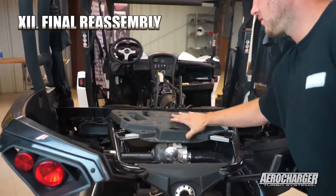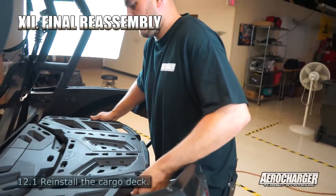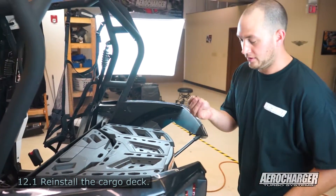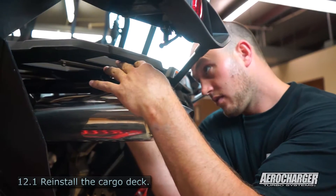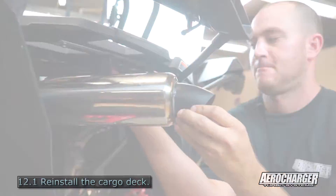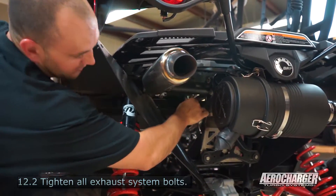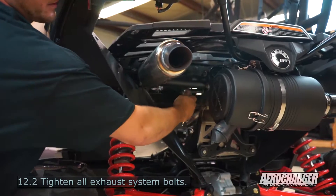We're ready for the deck install now — it's only going to be six bolts, all different lengths. The two longest ones go in the middle, two short ones go in the very rear from the bottom up. The one on the driver's side will be the one holding our exhaust — that's where I'm going to start. Tighten up the exhaust bolt — it's 10 millimeter. Now we're finally tightening up the exhaust to the turbo — it's a 13 mil, four bolts. Make sure you get them all nice and tight.